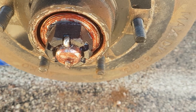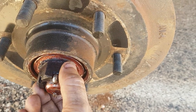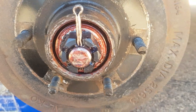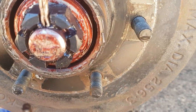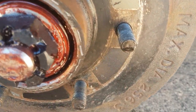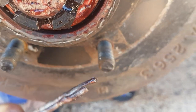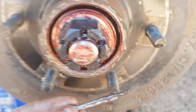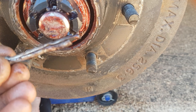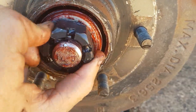Next, we're going to straighten the cotter pin out and then take that pin out, which lets us take off the castle nut. Just use run-of-the-mill pliers to straighten the ends. It pays to have a spare pin because if you keep bending and straightening them they get weak and can snap — if the end snaps off and spins around in there with your bearings, that's not going to be good.